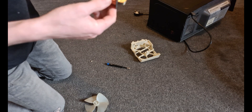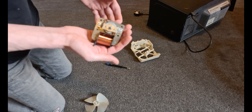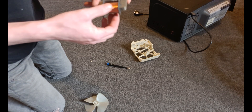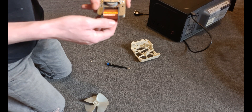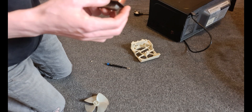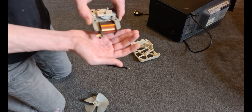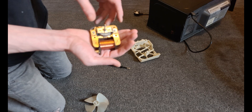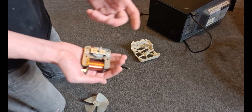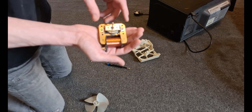If you pick this up from the street, you've got it basically for free. This is exactly the same jumper wire that I use for HDMI trace repair on Xbox Ones, PlayStation 4s, and things like that. You just coil it up onto a separate spool and you've got a lifetime supply — there's probably miles and miles of wire there. You only use around about 4 inches for a full 19-pin HDMI trace repair, so you really don't need a lot at all.